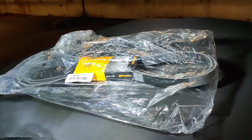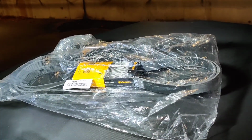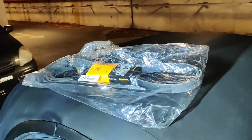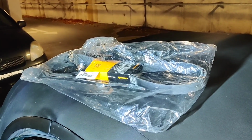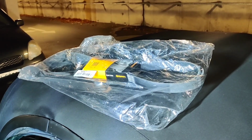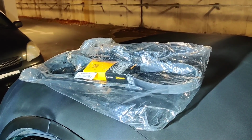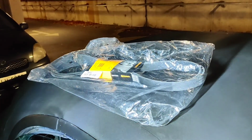It's meant to be one of the easier things that you can replace on the Boxster, but if you checked out my other videos, easier doesn't necessarily always mean possible, given the disaster that happened with the air filter. Now, in one of my other posts I did show how to get to the drive belt, and I have already inspected the one that's fitted. There's no real problem with it. There's no cracks or signs of wear, but because I couldn't see anything in the service history showing when it had last been done, I thought the best thing to do would be to not leave it to chance and get it replaced. Now then, I've got the replacement belt up there.